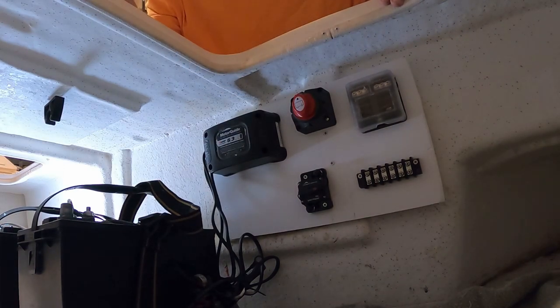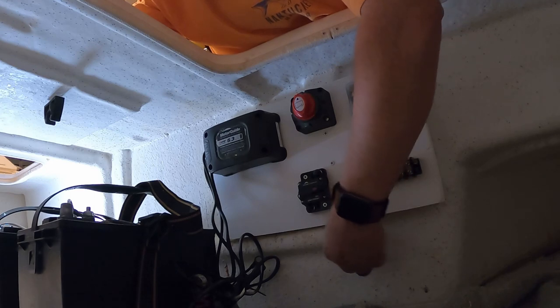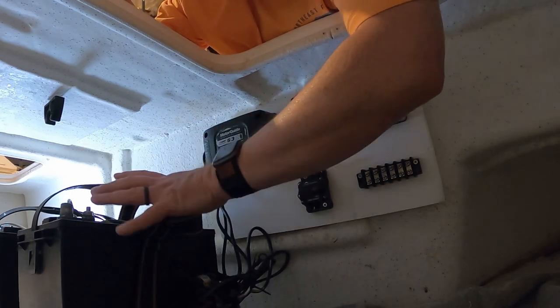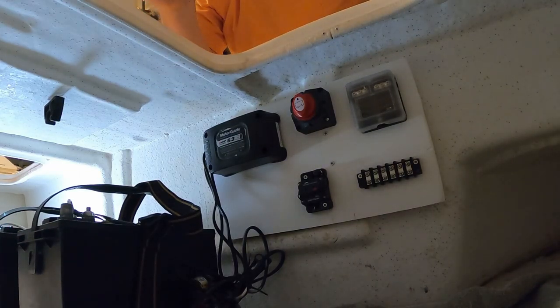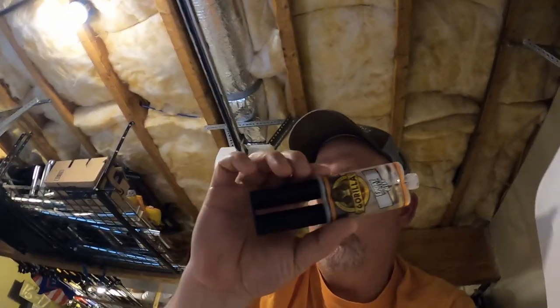It's got the Clear Grip and two screws. I'm going to add another screw right here — this is a little structure member right here at the front where I was able to drill. The onboard charger will hook back up to the two batteries, and it looks good. I'll mix up some epoxy off camera — it's just a two-part Gorilla epoxy, waterproof, with a five minute work time and 20 minute cure time. Got it done — so there is the board, it's on there.